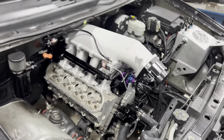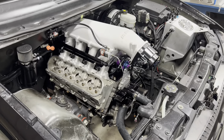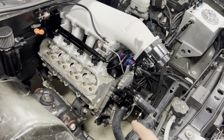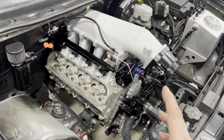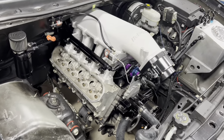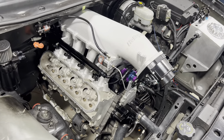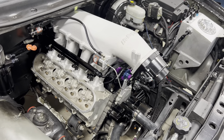Let's start up front, because this is where a lot of the work's been going on. We've got a mock-up block in this thing because the engine is already at Precision Racing Technologies. We've been waiting on engine parts — finally got the last little bit of stuff in, so Sean's hard at work. We decided to take the factory LS2 that we've been running cam-only, put a set of rods and pistons in it, leave the factory crank, and put a set of LS3 heads on it. He should have that back to me within a week, which gives us about a week left to get everything bolted back up.